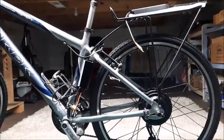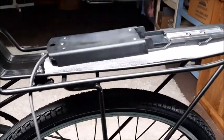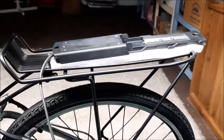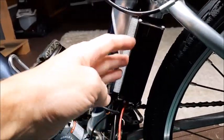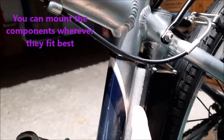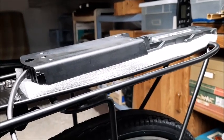I've completed a couple more things on the bike project. I've installed the rear luggage rack and mounted to that the battery mounting bracket, which is a quick release so I can slide the battery on and off the rack. The controller is mounted with a couple of zip ties, and I put some foam in between the tube and the controller to keep the metal from contacting metal and wearing down. I did the same thing up on the battery rack to prevent vibration from getting to the battery.